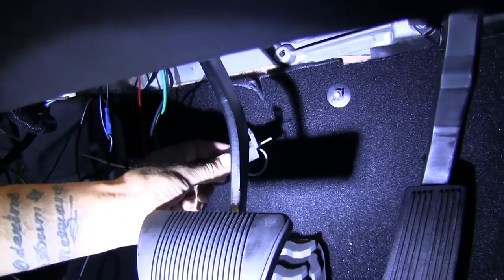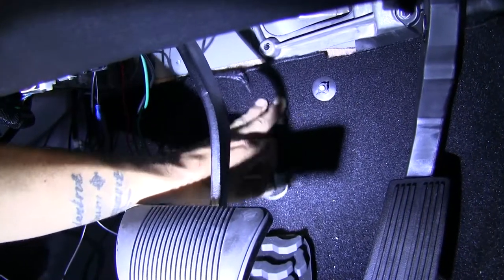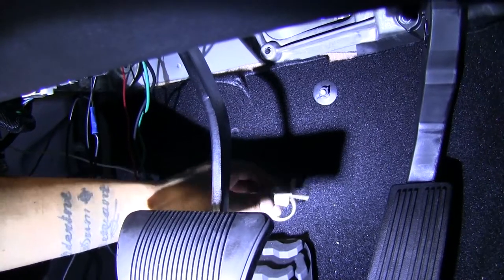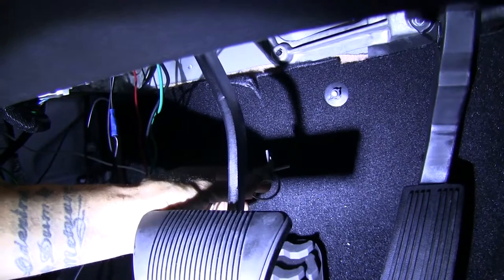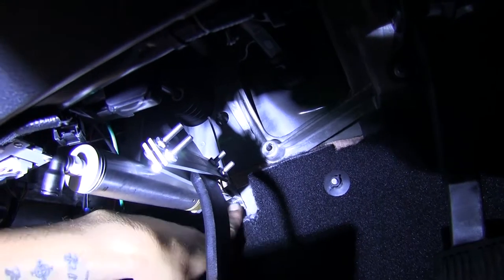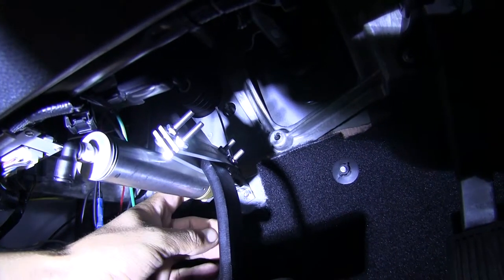What I like to do is mount my actuator first, and then I can take my cable and anchor end — you're going to want to cut away all the carpet and any insulation. You're going to want to go directly into the metal on the firewall with your anchor point. Now that we have our actuator installed, you'll see the grounding anchor is going directly into the metal, and I just cut that carpet around it.